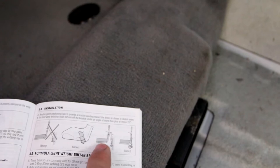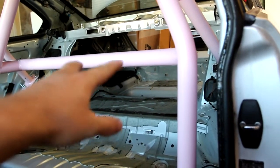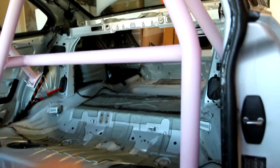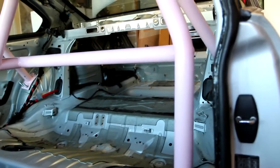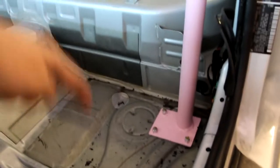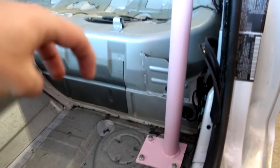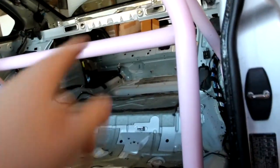I'm going to run my shoulder belts on the shoulder rail of the roll bar. If you don't have a roll bar and you're doing this — which I highly don't recommend — you should have protection in the car if you're running a harness. If you choose not to mount it on the roll bar, don't mount it directly to the floor. Mount it back near the rear seats closer to the C-pillar, because if it's mounted low and you get in an accident, the harness will pull down on your spine and compress it.